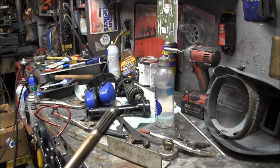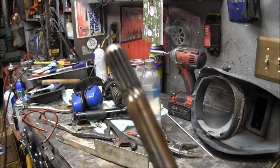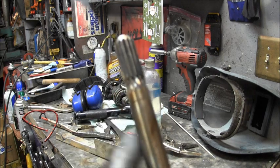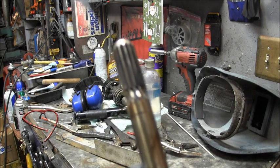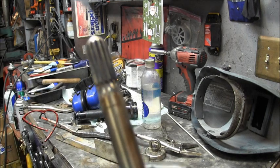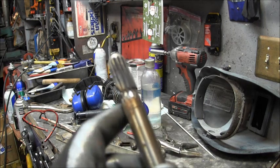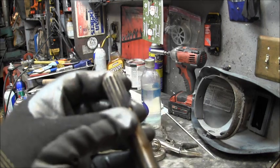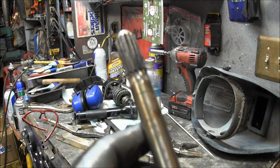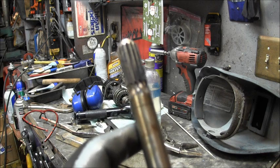Okay. Now, hopefully, whoops, I'm hitting the leg of the tripod. Hopefully you can see, here's the bent. Hopefully you can see the line there where it snapped, right there. And you can see how nice and straight I've got all this. Now there's my ugly welds. That'll get cleaned up really good. And then we'll come over here, and once I clamp it, that little crack will even push together tighter. I'll make my bevel at the bottom side of this mostly, and then I'll come in and fill that with weld. And I'll cut literally halfway through this drive shaft to get it done.